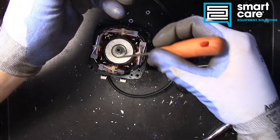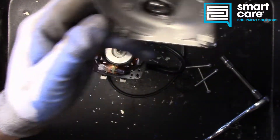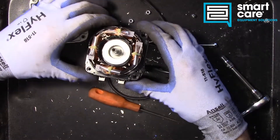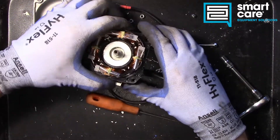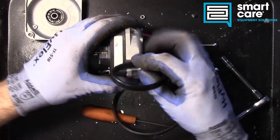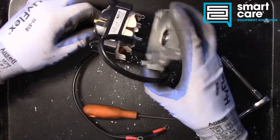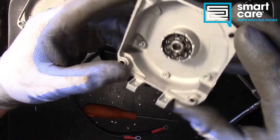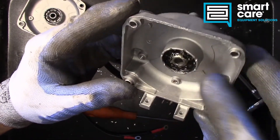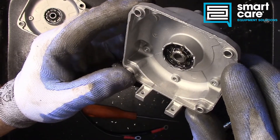So the metal of the motor shaft actually rides directly on the metal of the bushing material. If we work this apart, you'll probably find another bushing in the back here too. And yes, we've got the same situation back here — there's a little bit of grease in there, but not much, and just another bushing with the retainer pushed in on it.